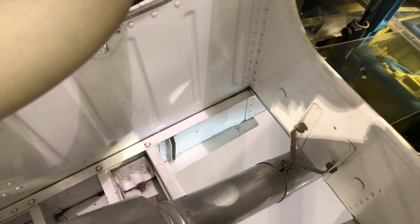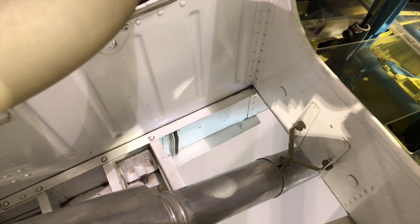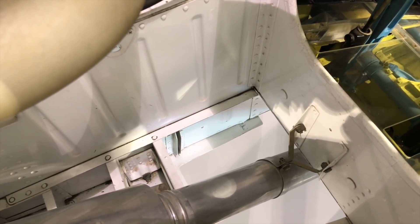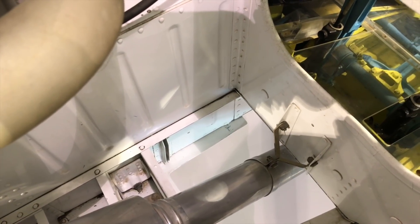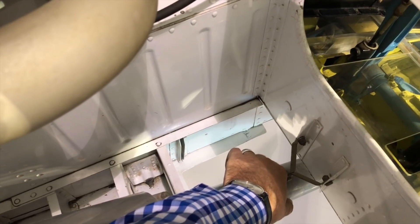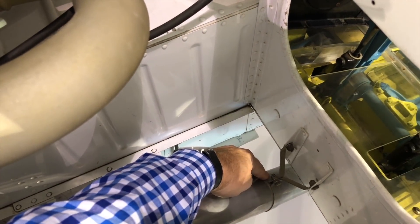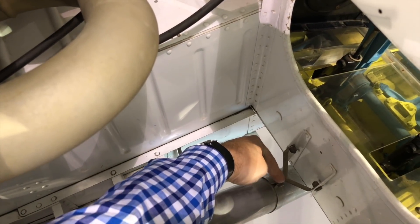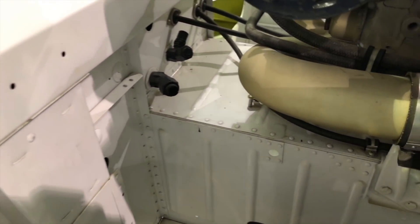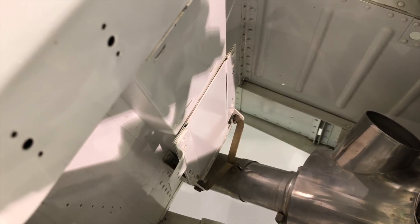While I'm here — very common area — almost every single airplane I've seen at service clinics had this issue of these brackets being positioned incorrectly. I think these are positioned incorrectly on this airplane as well. These should be on the outside so that this thing can be tightened up more. Otherwise this thing can be loose. So this clamp should really be clamping it — if you put these on the inside it can get loose. I'm surprised on a Beechcraft that would be done incorrectly. Both sides appear assembled incorrectly on this airplane.